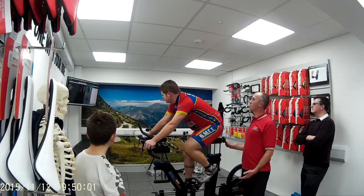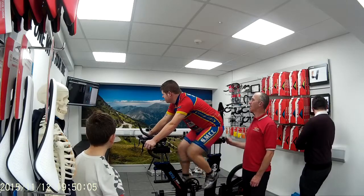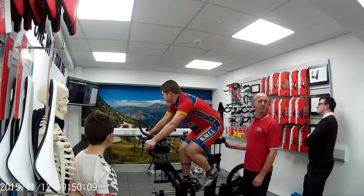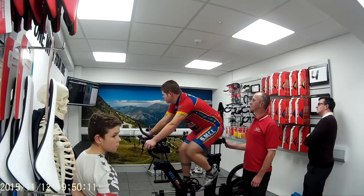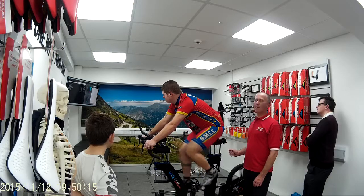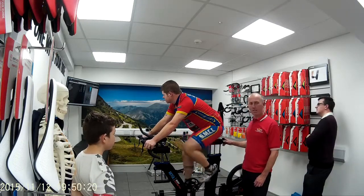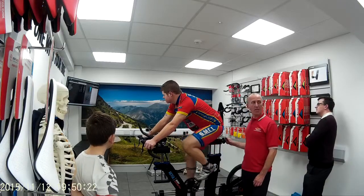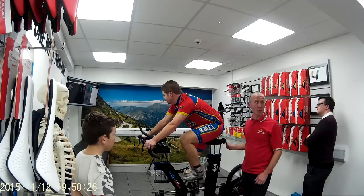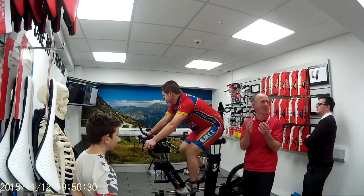Okay, so we know that we're too high there now. We've got all those red numbers, so we went too high. So we need to come back down again. When I've got an Allen key in your seat post, you can see that I'm moving this 2.5 mil per turn. It's really hard to see with my eyes, 2.5 mil on the seat post. Sometimes you go past it and go, ah, should have left it alone.